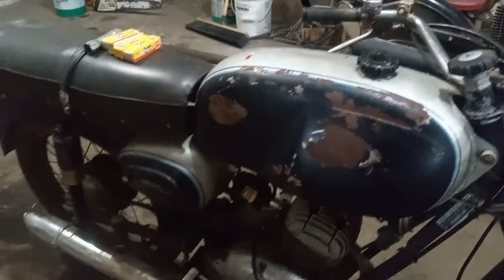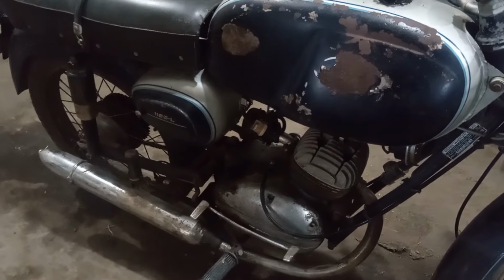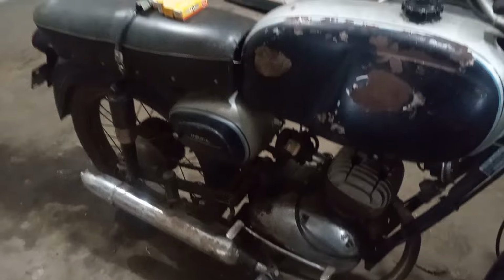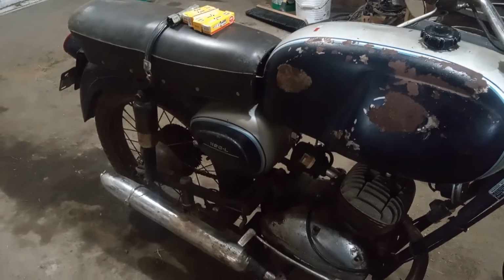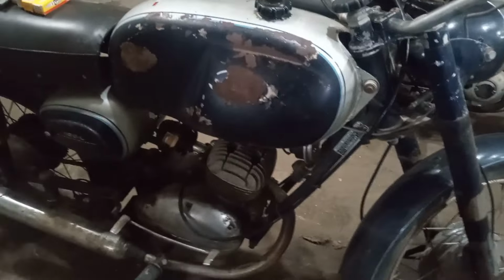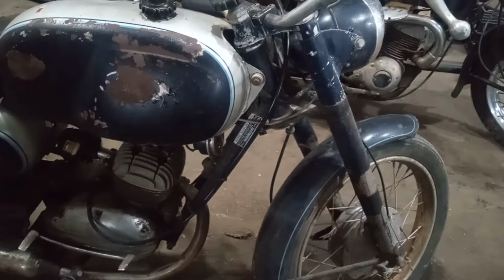But basically on these old ones, especially a two-stroke, they're so damn simple. If you can get the carburetor cleaned out, then the fuel tank cleaned out, odds are they're going to run. There ain't much to go wrong. But spark plugs. So I had to hunt up them damn spark plugs. Very fun bike to run, though.